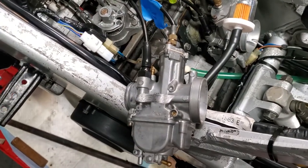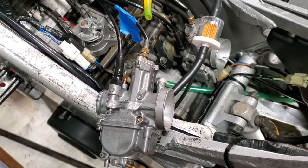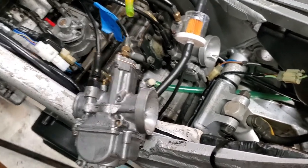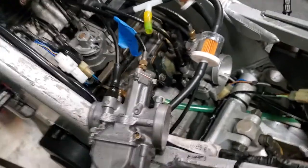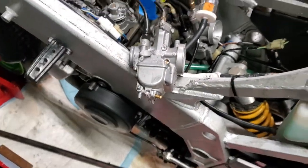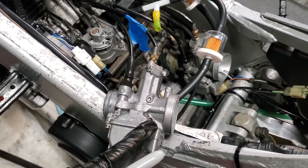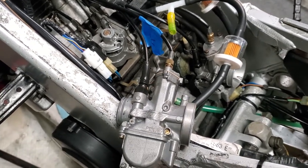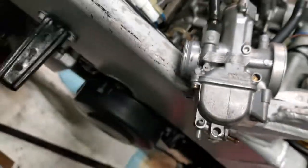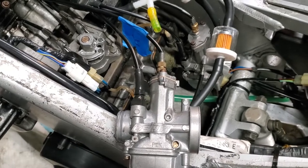The carbs are rebuilt but I couldn't get it running. There does appear to be fuel in there — I loosened the nut on the bottom of the bowls and saw a little fuel dribble out, so I knew fuel was getting in. This is a two-stroke, so I looked up the air/fuel mixture screw setting and found I had it wrong. I could be a little off because this bike has been modified slightly.